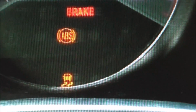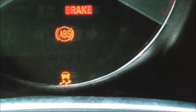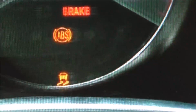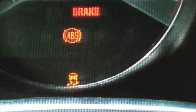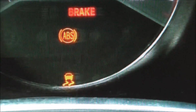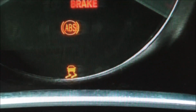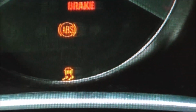One thing that I did forget to mention is that the metal style clamp-in TPMS sensor is good for 155 miles per hour per the information that I saw over on Rock Auto, and the rubber style snap-in TPMS sensor is good for 115 miles per hour. Now, I don't plan to do either one of those speeds, but I would have preferred to have the metal clamp-in style because it just looks more rugged and heavy duty.